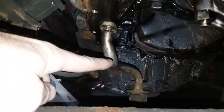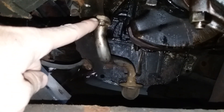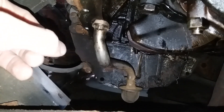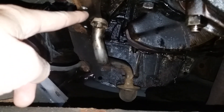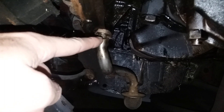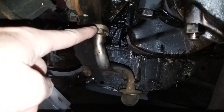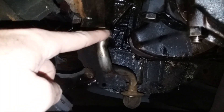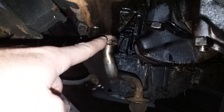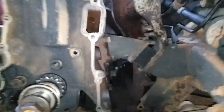Underneath the truck, this is the oil pickup tube. There's an O-ring here between the block and the tube itself. When I took this down, that O-ring was just crumbly — hard plastic, just coming apart. Low oil pressure may be a result of air getting pulled in through this. I took a generic Buna O-ring, matched it up with the size, put it in there, and bolted it all back down. If anyone's experiencing low oil pressure, this is an area of concern. If you ever take the pan down, replace this O-ring.